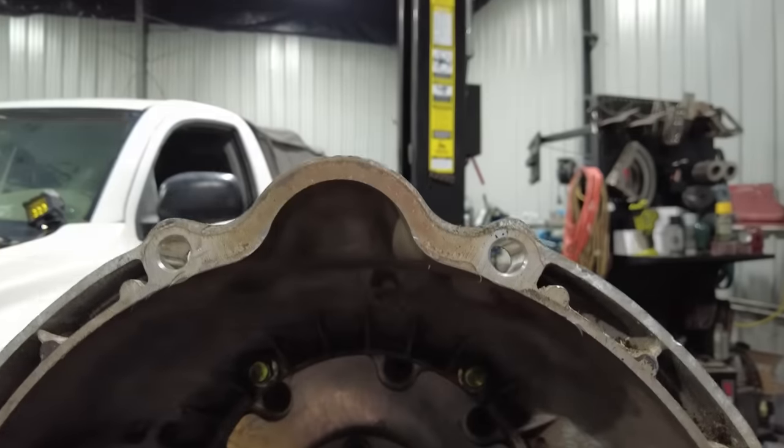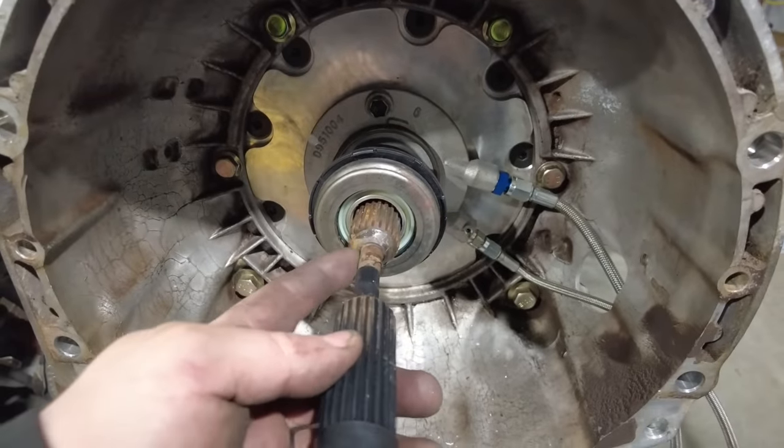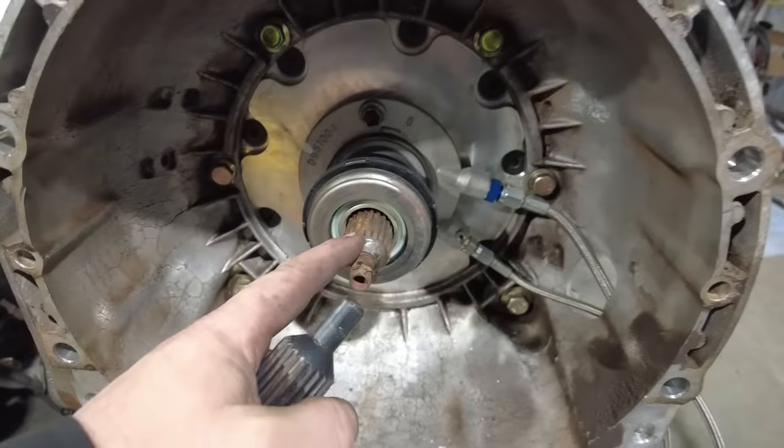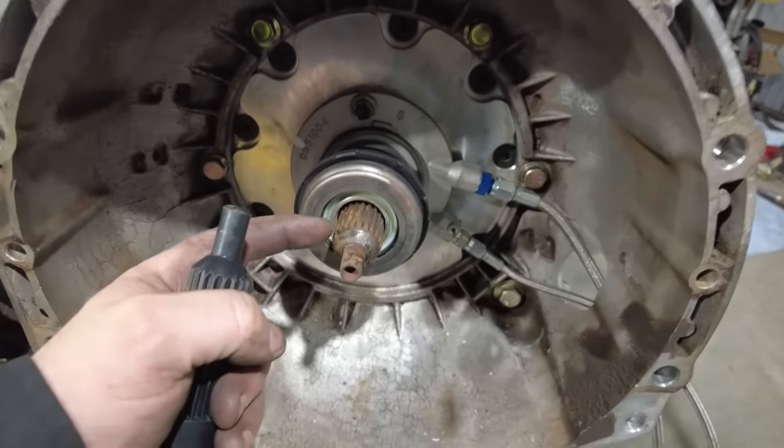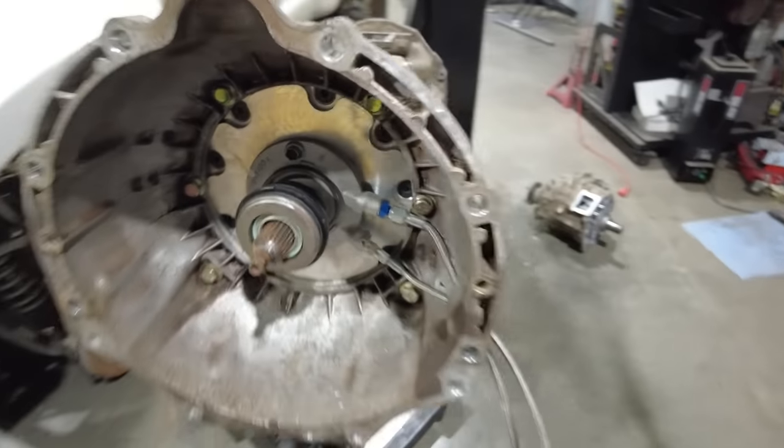Another thing that I also do in cases like this, where I've got a lot of different parts mashing together that I've never really done before, I come over to the transmission and I make sure that the adapter tool has the same pilot bushing. I'll actually try the pilot bushing on the transmission, which I did. And then before I bolt the clutch up to the engine, I make sure that it splines onto the transmission input shaft correctly, which this one did.